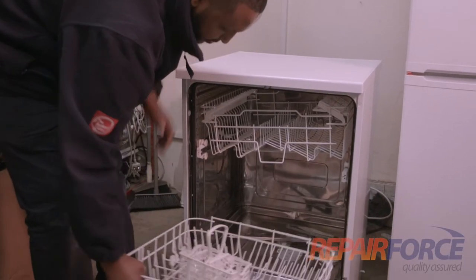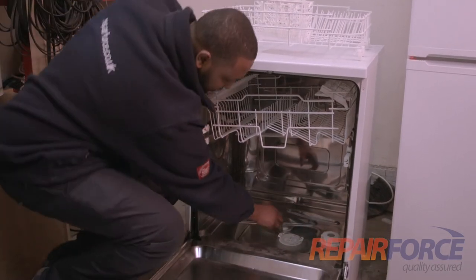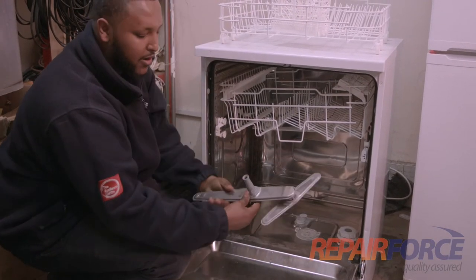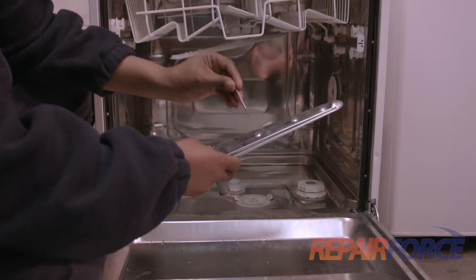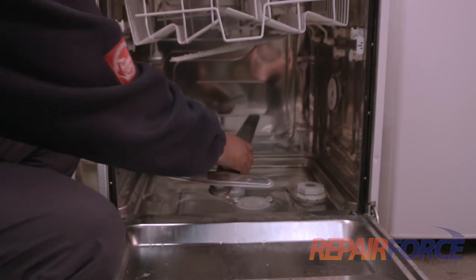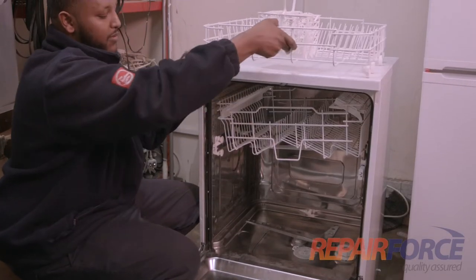By taking the bottom one off, remove the bottom shelf and place it on top. Removing the bottom spray arm just lifts up on this type of model — some models vary. Same thing: unblocking it, make sure there's no blockage in the spray arm. This one looks fine. Placing it back in, push down — you hear that click, which means the spray arm has gone in perfectly.